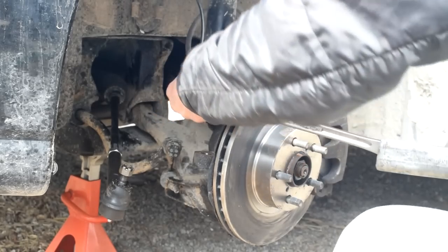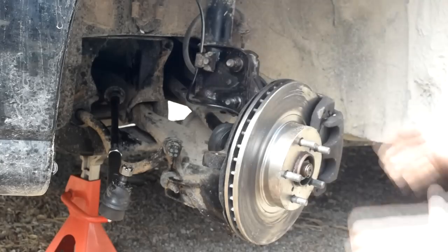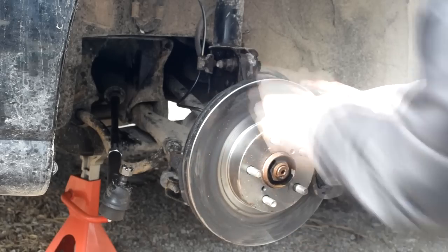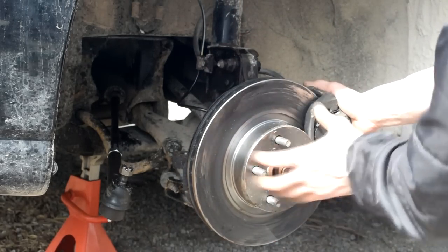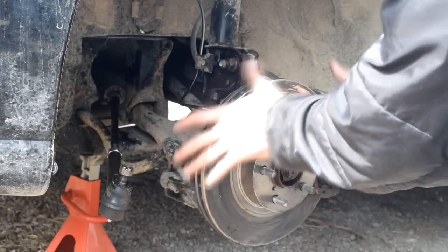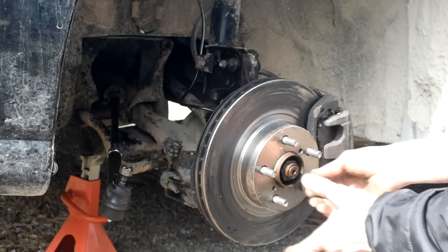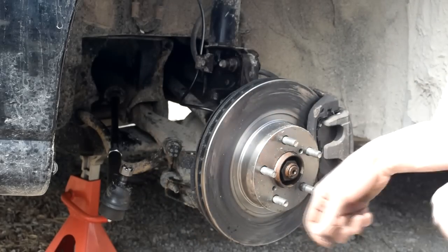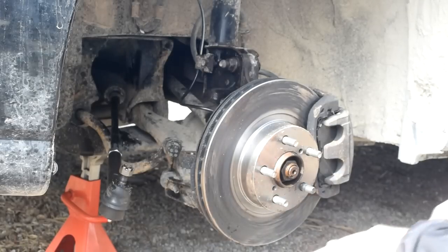It's easier to loosen the nut than trying to get the bolt. I'm going to leave them loose right now because I might have to put the tire back on to break the axle nut loose — when you try to spin it, you just start spinning the whole wheel, especially with an automatic transmission. So I might have to drop it down, put the wheel back on, and access the center hole with a breaker bar and extension.